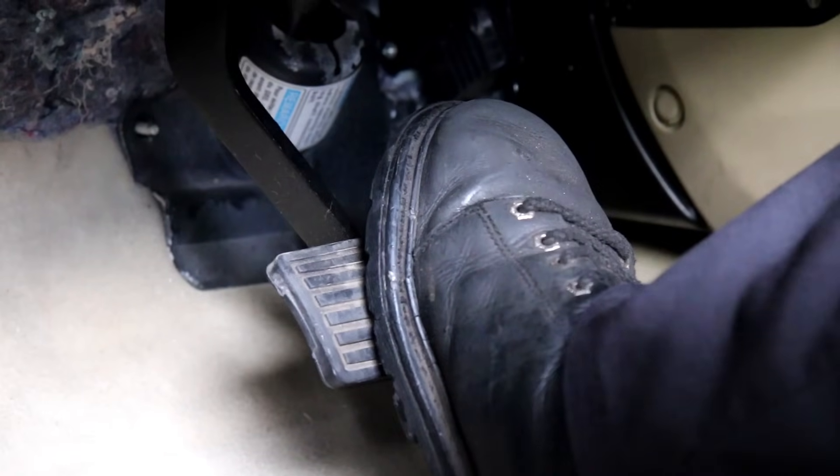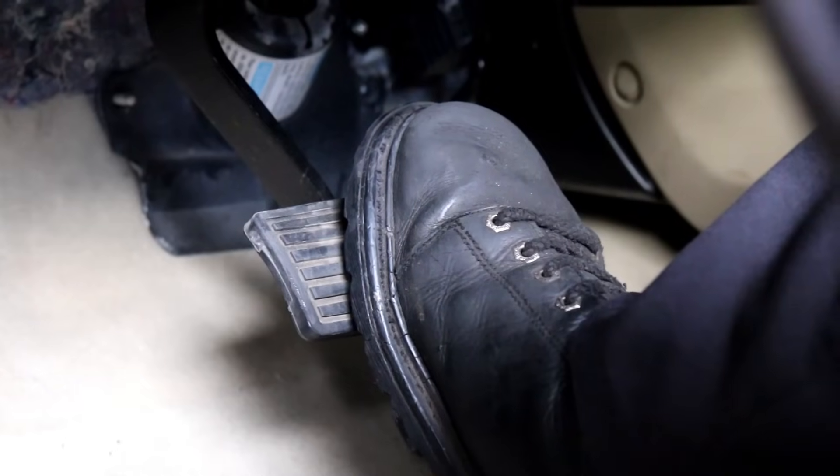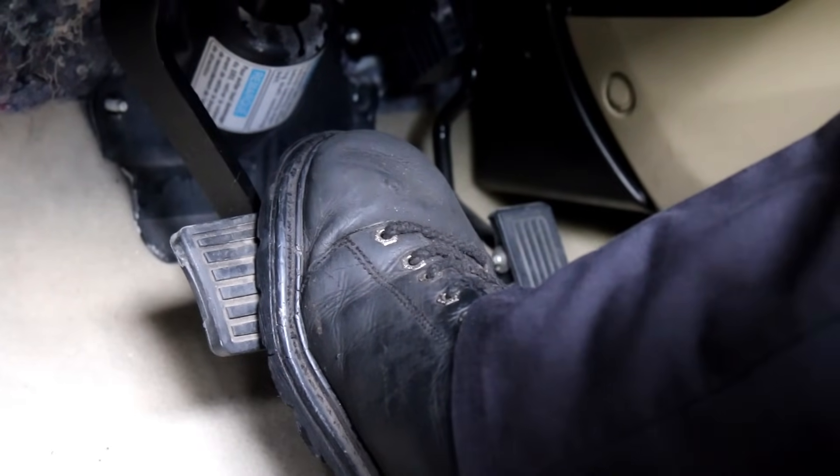If you're hearing loud noises and the vehicle feels like a death trap with all kinds of wobbling, that may be an indication you don't want to buy it. During the road test, start with braking. As that vehicle brakes, you want a nice smooth stop. If you've got a pulsation or vibration while braking, that's an indication you may have a warped brake rotor — not the end of the world, as it may be resurfaced or replaced. However, if the brake pedal starts to fade all the way down, perhaps triggering a brake warning light, that's something more major requiring more attention.